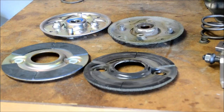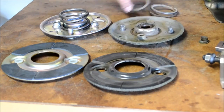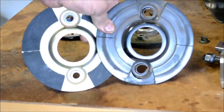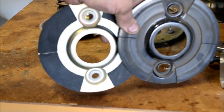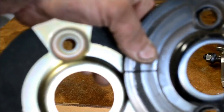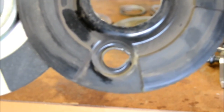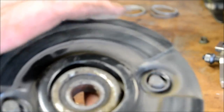I've got the new parts here. Got the clutch spring — it goes there. Here's the broke one. Kind of do a little side-by-side comparison here. As you can tell, the clutch disc on the new one has the little nyliner bushings. The old one, as you can tell, has had the bushings long gone and has been wearing metal on metal on the clutch holder. Whenever the mower is running, it's constantly making all kinds of racket and banging and clanging and knocking.